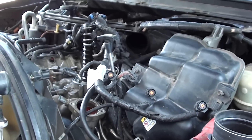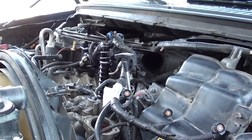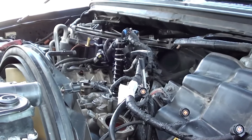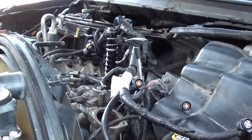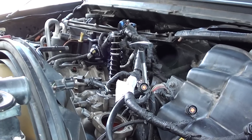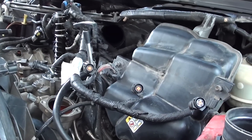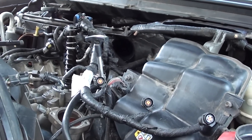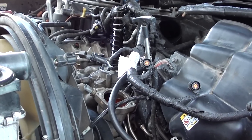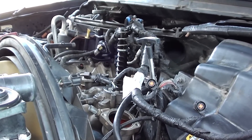About a week ago I ordered a bunch of stuff from Innovative Performance Research — IPR. I was having some, not really a big issue, but I noticed my coolant temperature was about 20 to 30 degrees cooler than my oil temperature. After doing some quick research, figured out that my oil cooler is clogged, and that's kind of unfortunate because I just had all this stuff off a few months back doing the head studs.